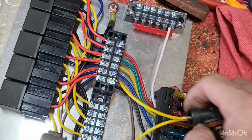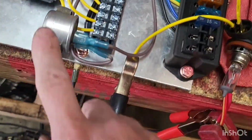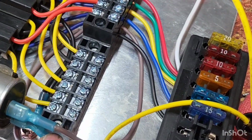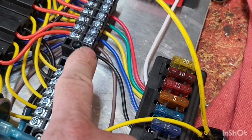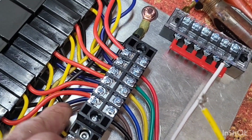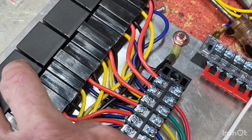And we have our flasher. Now each one of those relays is controlled by this two-pole flasher. You just have power running into the bottom, then power out, which splits into two on this bottom bus bar down here and powers both of these relays.